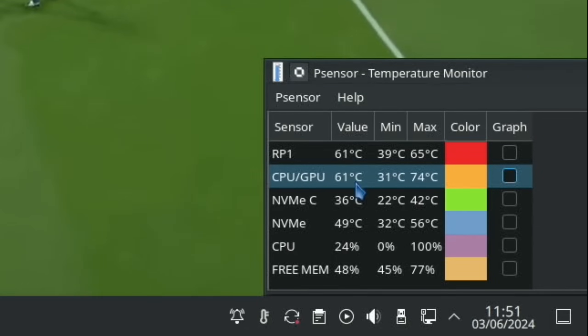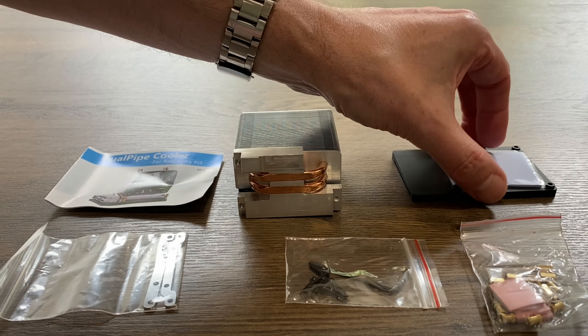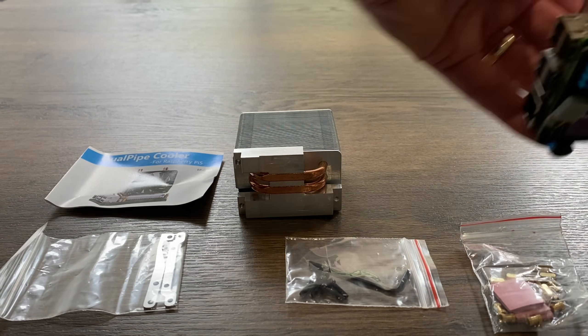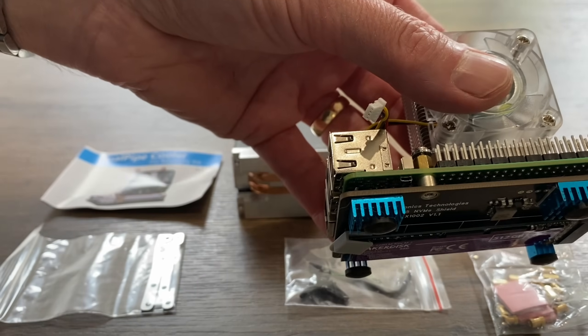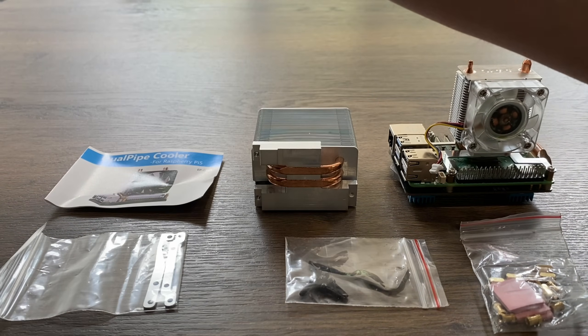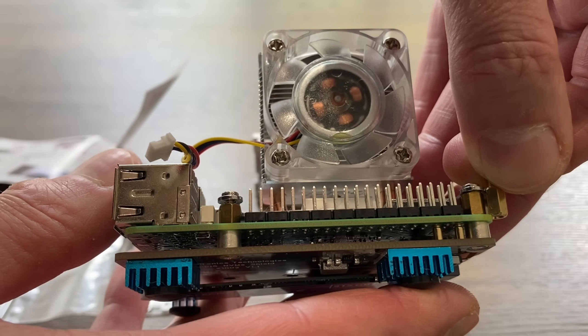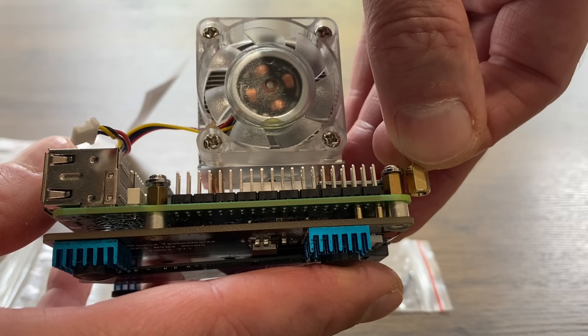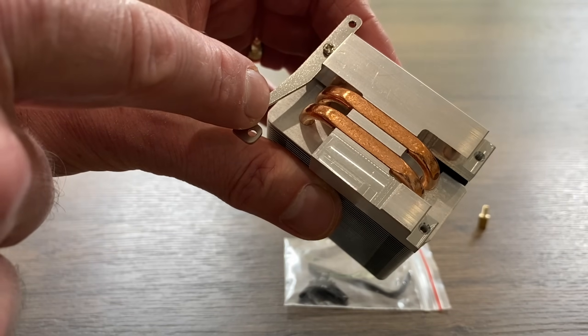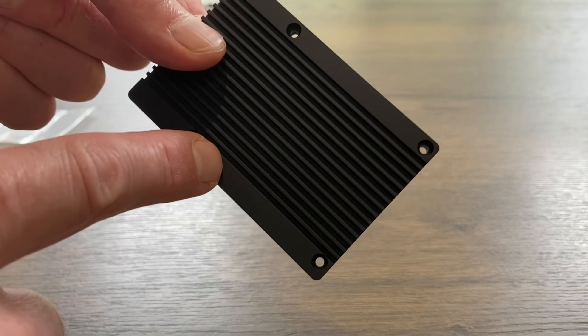This is what's in the box: an aluminium base and a large thermal pad for the bottom of the Pi. I'm not going to use the base pad purely because I've got an NVMe drive on the bottom — I think it's a better setup for me and I'll still get the main benefit from the big ice tower cooler. Hopefully these bolts are the same height as the existing ones — it looks ever so slightly taller so I will have to swap those around. Attaching the two arms to the board — that's all in place with three screws. The bolts do go all the way through, so it probably does lend itself to having an NVMe drive with some spacers.